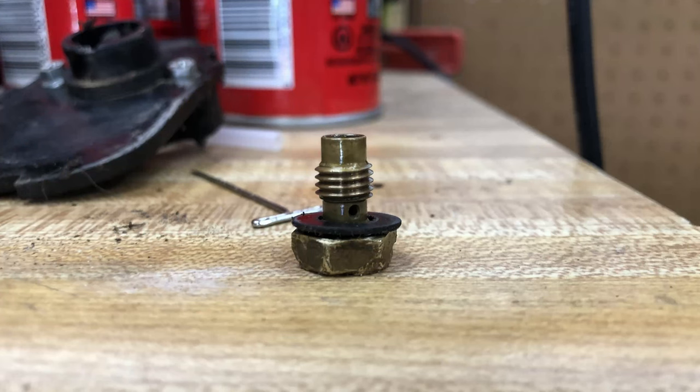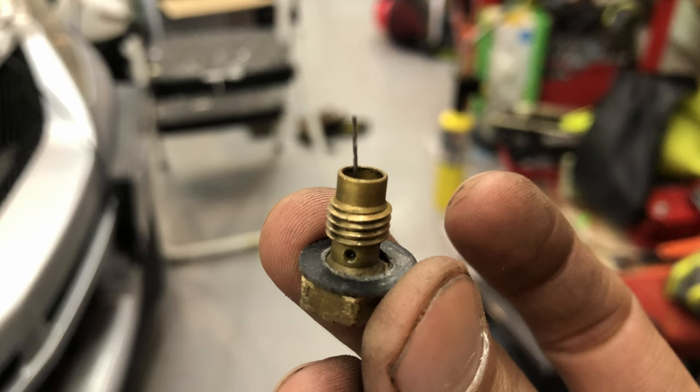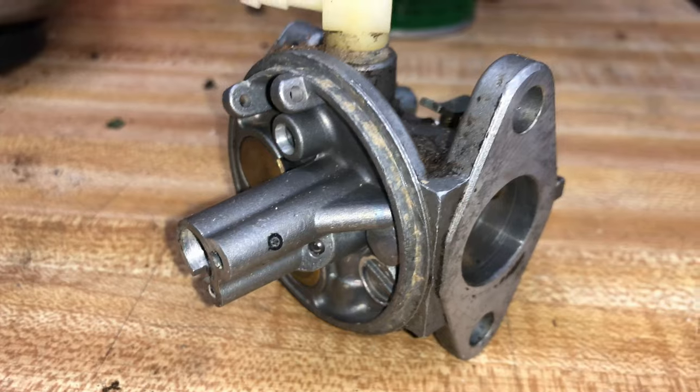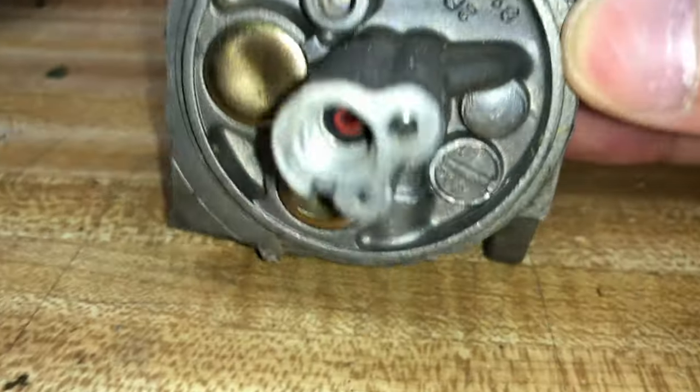You can clean the holes out with Coke or extremely thin drill bits. That should fix the problem, but if not, you may have to take the entire carb assembly out and do a deeper clean. With all the ethanol fuel mixed in nowadays, it is not unusual to find green gunk all over, especially on these small holes, and there are several of them.